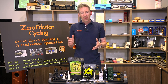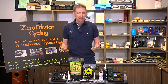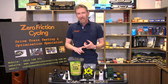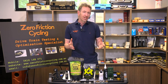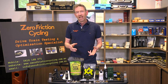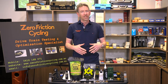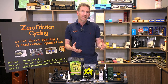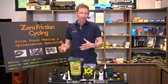Lubricant types — most of you would have heard of wet lubes, which make up probably the majority of lubricants on the market. You will have heard of dry lubes. In dry lubes there are two main types: your older style traditional dry lubes such as Muc-Off Dry and Finish Line Dry, and then the new generation dry lubes, which are more of what we call a chain coating type lubricant — lubricants that set to basically a true solid on your chain, really trying to emulate immersive waxing in a bottle.